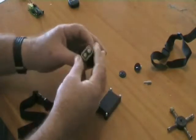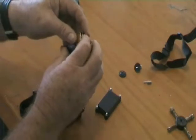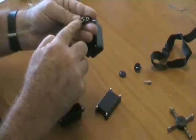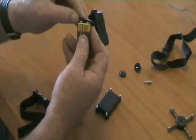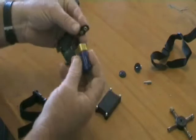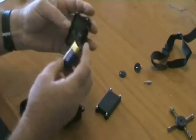One of the problems they have, these 9-volt batteries, is these female connectors. When you connect the battery and then go to disconnect it, people tend to roll it off because they're quite a tight fit. What that does is it stretches these little segments out so that you'll see now, that one's quite loose. That'll cause the collar to play up no end, so to fix it, just pinch it together with your fingers like that. Okay, and when you connect it, push it straight on if you can, don't try and roll it on because you'll only stretch them again.